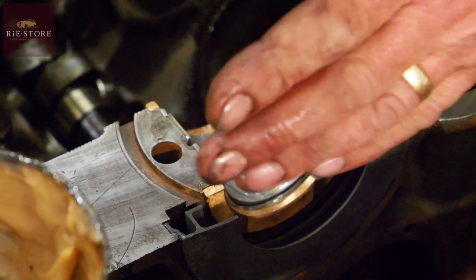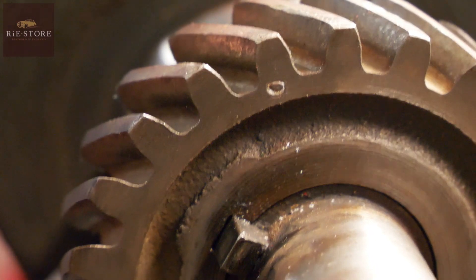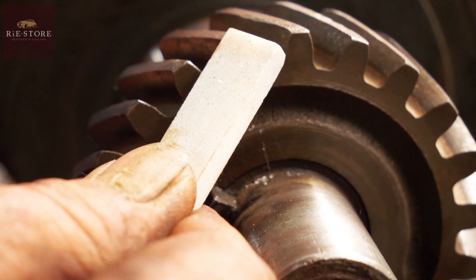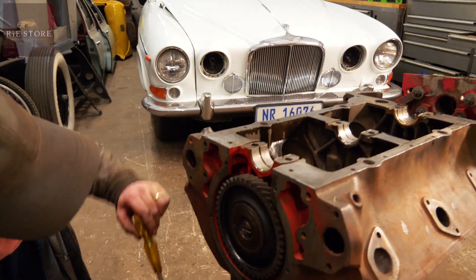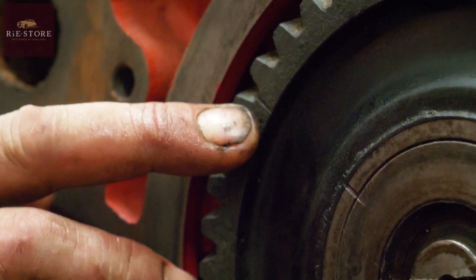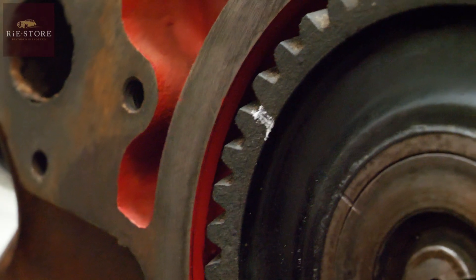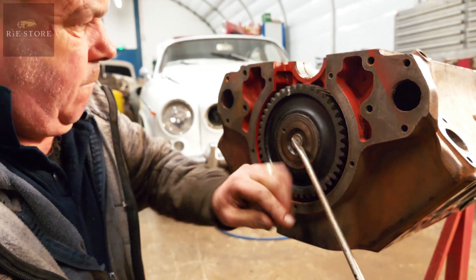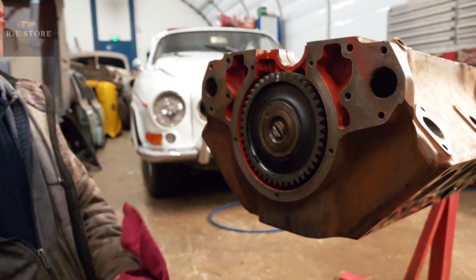Those two take up your thrust that way on the crankshaft. That's your timing mark - that times the crankshaft to the camshaft. I'll just mark that so I'm not in the wrong hole, and turn the crank till it's up at the top. The camshaft should be in line - there you go, see that mark there? So that tooth has got to go in that V. If I turn it around to the top, we drop it in and we should be about right.